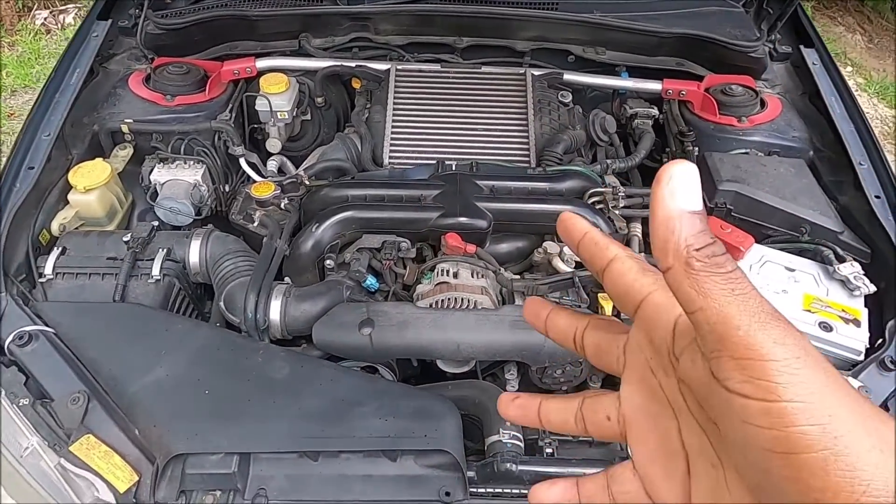In our case — Japanese domestic market — the car may need to be tweaked for what you intend to use it for. Subarus tend to knock very easily. Higher compression motor in this one, and a Japanese domestic market tune calibrated for higher octane fuel — that is a recipe for disaster. What I noticed was that our car just was not behaving right, so I went ahead and recalibrated it for our fuel, which is 91 octane. I believe what they get in Japan is closer to 100, so it was knocking pretty bad from factory.